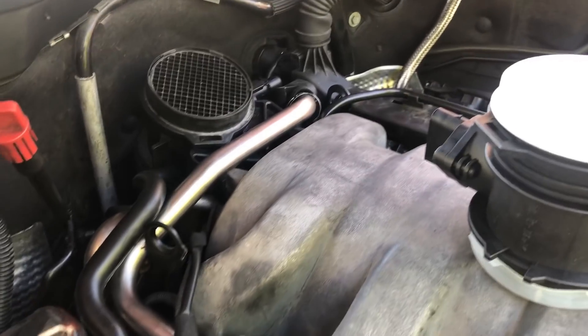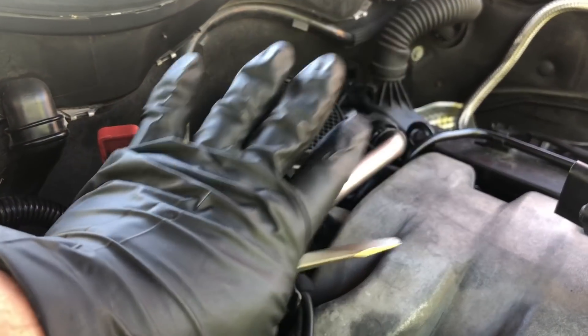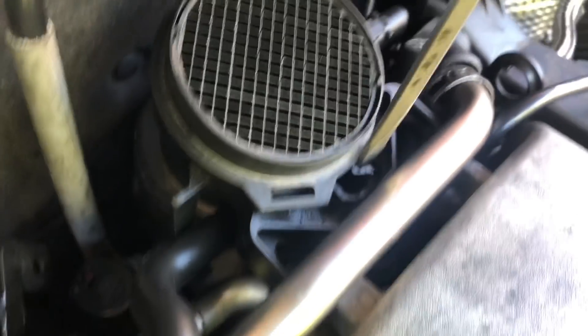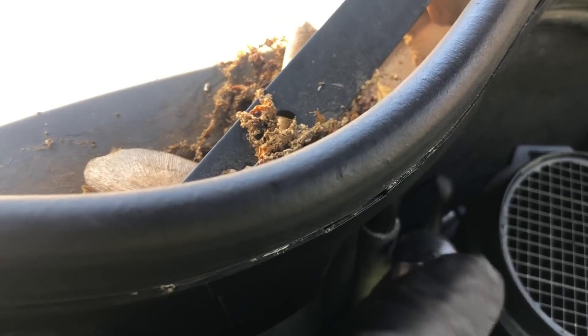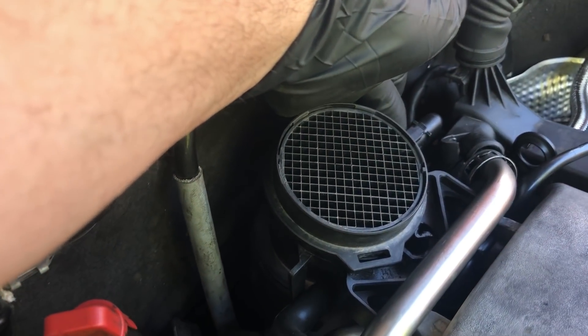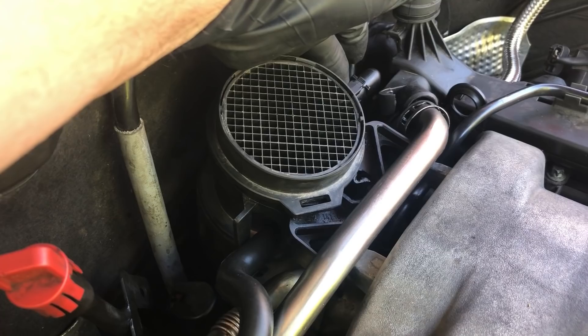I've already removed the engine cover — it covers all this kind of stuff. This is the new mass airflow sensor; this is the old mass airflow sensor. These are super easy to replace. First thing you want to do: there's a little plastic bracket right here and two little pieces that come together. Push this and separate the two and the plastic bracket will come off. Then behind here, see that little silver clip right there? Get a screwdriver, push that back out of the way, and then this part just kind of comes off. Then you can unplug the electrical connector right there. Install the new one just the opposite. Super easy to do and we'll do it in record time for you.